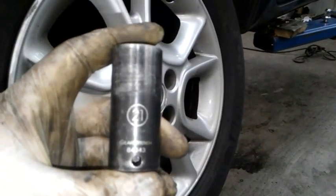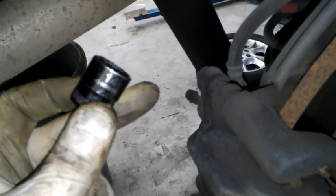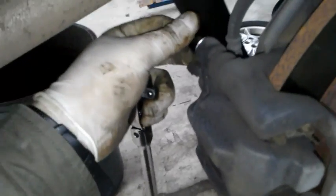It's going to get started here first. You're gonna need to take your wheel off at the 21 millimeter. So once you get your wheel off, you want to come over here and get the caliper bolts off. They're a 14 millimeter.